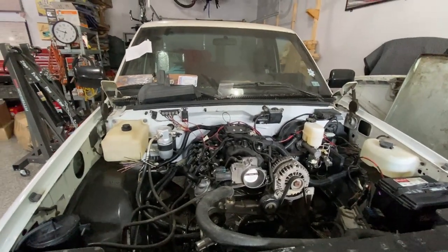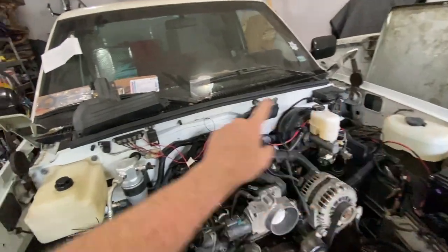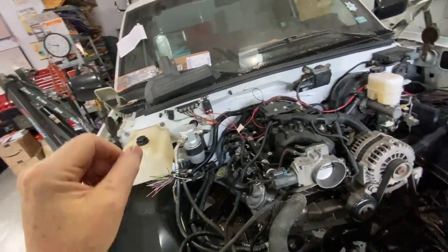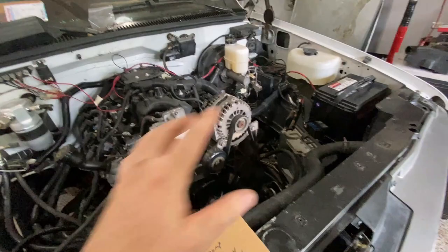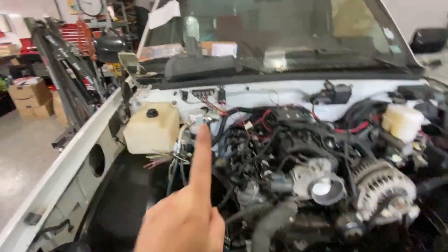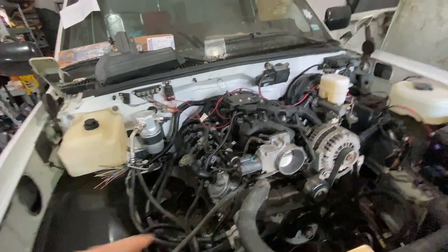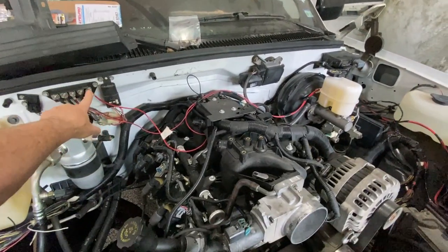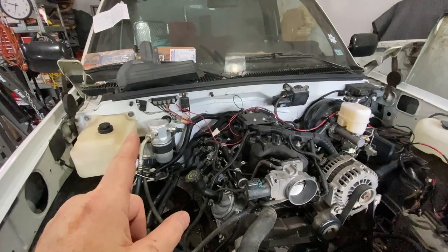Let's start with the first wire, the most important one — the red wire. The red wire on my 91, from the computer, I connected right here. The battery is a totally separate thing. I'm going with the three main wires that come off the PCM to make it run, or your relay control, which would be your red for power, which I connected right here. The reason I connected it there on the OBS is the battery connects directly to the starter, and there's another wire that runs from this location to the alternator — that's my hot. That's why I chose that stub out for my power.